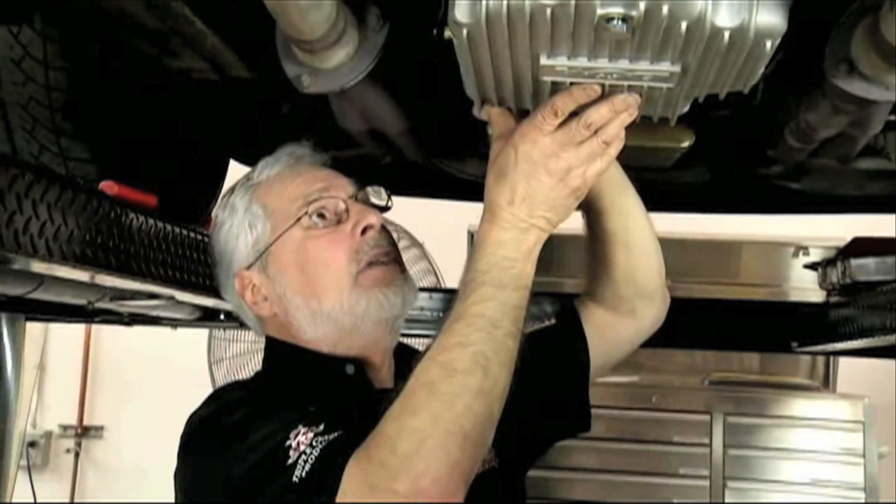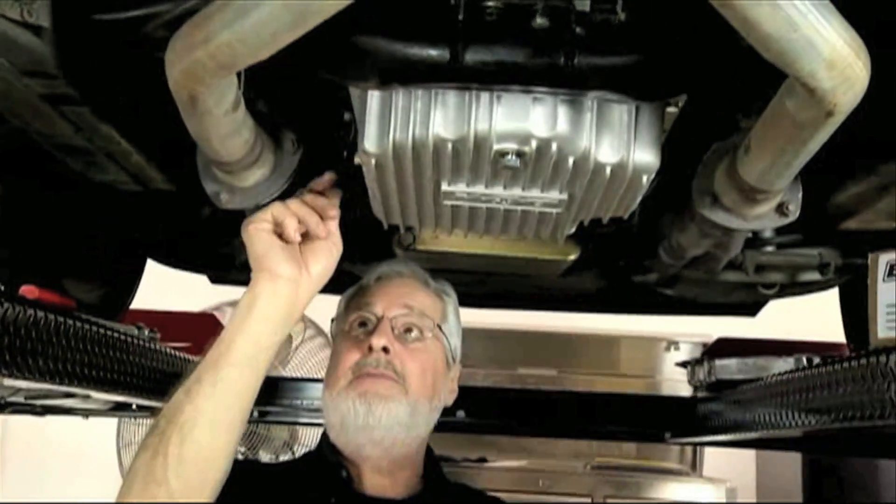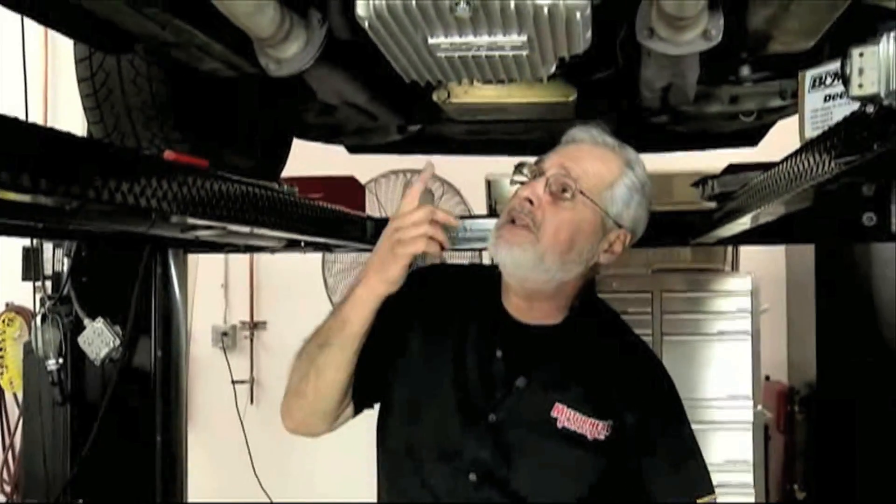I put the gasket on dry — it's a nice cork gasket. You've got a real thick flange on this beautiful aluminum pan, and we're going to follow the torque specs. You want to talk about getting in trouble? RTV — room temperature vulcanized sealant — you never use that with a gasket. You can use it in place of a gasket, but never with one. If you want something to keep the gasket in place, use a little string through a couple of holes that you can pull out, or some actual gasket adhesive. On a transmission pan, it's sudden death with RTV — when you bolt it up and it squishes and makes spaghetti that goes down inside, it can get picked up and hit a governor or a valve in the valve body, and then you've got something you have to take apart again to free up.